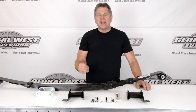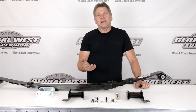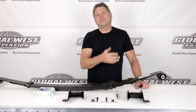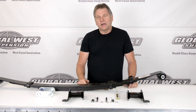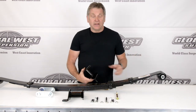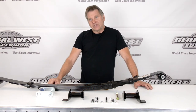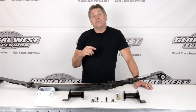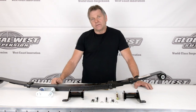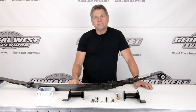We run reverse eyes in all of our high horsepower autocross, road race, and some street applications as well. Being a Cat 5 system, it's especially unique because it doesn't increase the spring rate in the rear when you're going around a turn — it's not a rising rate. So the leaf spring appears to be softer on the car, which allows the tires to hook up and you accelerate harder out of the turn. We also have this new LSB71 mount, which is designed to go with reverse eye leaf springs — if you run a reverse eye on those applications, you will require the LSB71. We've got a Firebird in the back where we're going to be installing these Cat 5 leafs and the LSB71, so let's go install this and show you why a Category 5 leaf spring with the bearing system is the way to go.